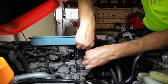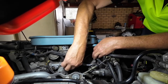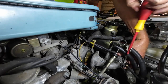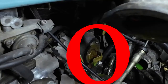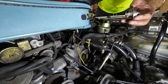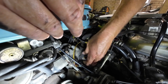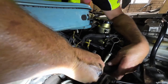With the drive shaft back where it belongs, I took the unicorn for a few runs in my local streets and I noticed it was running pretty warm — the temperature was about three quarters on the gauge. So next I tackled the thermostat. Turns out the old one had a broken arm and it wasn't opening fully. Pop out the old, pop in the new, install a new gasket — don't forget that — button it all up and don't forget to top up your radiator fluids afterwards. Not a hard job, just a bit fiddly and messy.